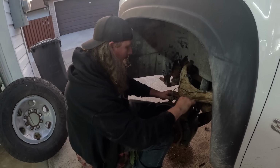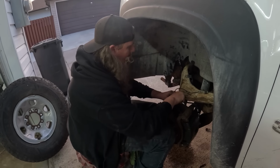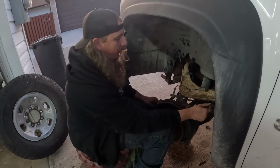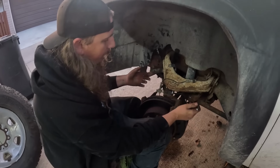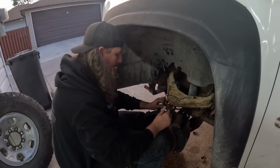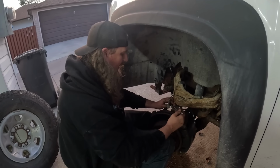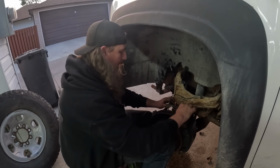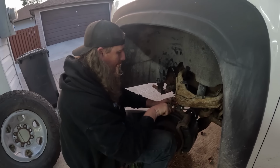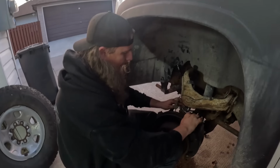The way to diagnose it, when the brake's sticking, is to release the bleeder. If the line is holding fluid, that's very common on these trucks. The line inside just kind of collapses and then it flows one way because it's under pressure, but on the way back it's not as happy. And otherwise it's probably the caliper. So that's all fine and good.